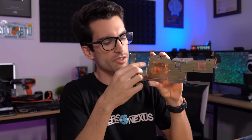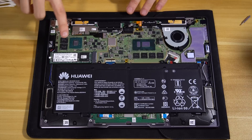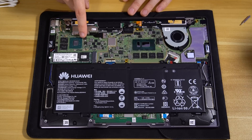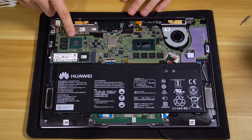Now that the plate is totally cleaned off, we're going to try to mask off the area where the copper is going to make contact with the liquid metal. There are little indentations here that show the perimeter of where each die will make contact with the copper. We want to apply liquid metal to both sides of the copper block. Before that, we need to protect the SMDs surrounding particularly the GPU — you can see the die in the center with small SMDs wrapping around.